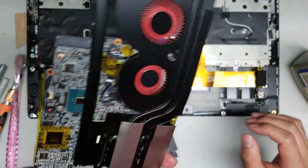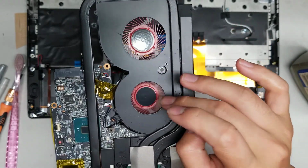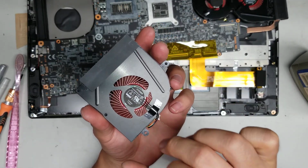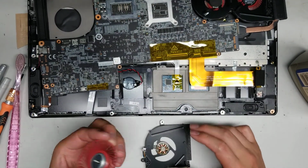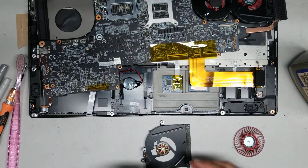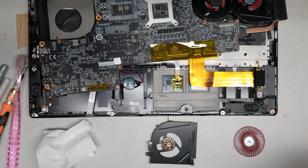Usually if the fan is well lubricated, if you turn it, as you can see, the fan kind of wiggles back and forth. See? So these fans are good. This fan, if I turn it, it kind of just stops. It does a slight wiggle, but it stops. So usually if that's the case, I take the fan back out, get a piece of paper, clean the oil off, and then just put another drop of oil. And I'll repeat that until it kind of wiggles freely. Okay.